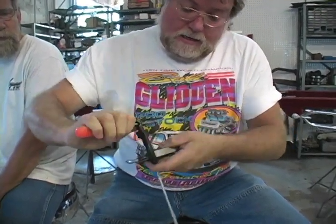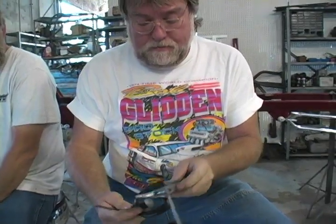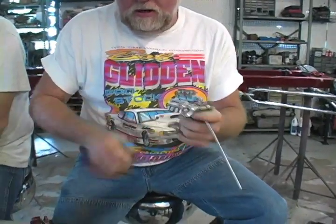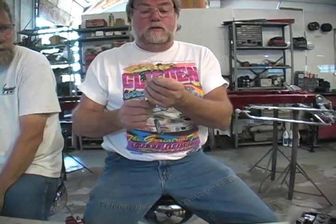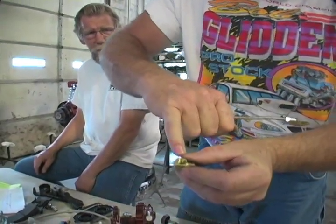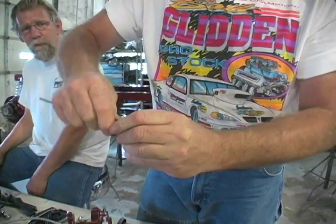Just tighten it up a little bit, back it off. You don't have to torque it down like you did with the first step. Loosen your clamps and pull it out, and there you can see you've got a double flare. Then you can put your tool on there and you'll see that it's flared out all the way around. And it's inverted, tapered there, so when it goes into the fitting, you see the fitting that is flared — then you've got a nice leak-free connection there.